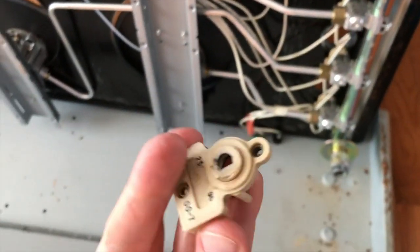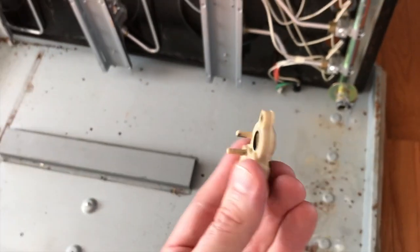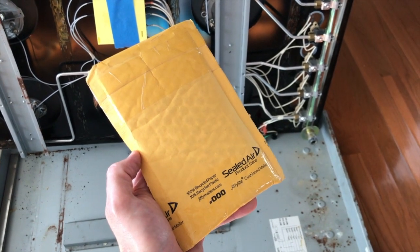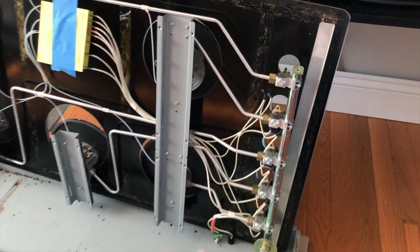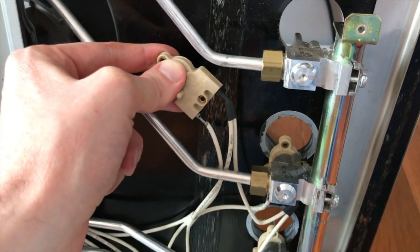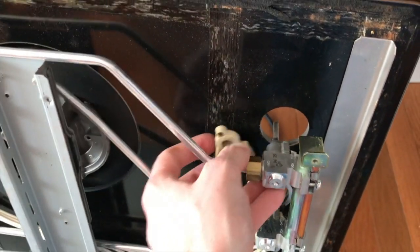There is your old faulty ignition switch. Let's toss this in the garbage and grab the new one. The brand new ignition switch has arrived — let's open it. With the brand new ignition switch, we'll reverse the steps and connect the electrical connection points. We will reference how all of the other ignition switches are positioned and position the new ignition switch accordingly. Both electrical connection points are properly secured.